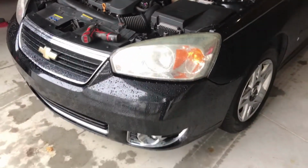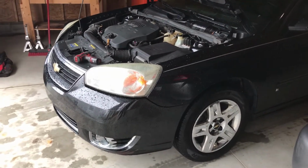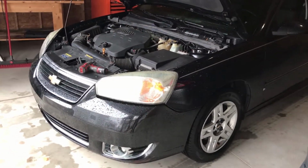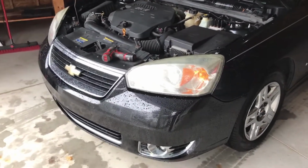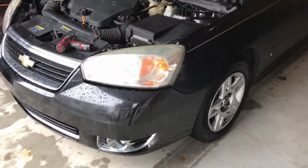We know these cooler lines are leaking because we're starting to find drops under where the radiator sits, right there. Especially when the transmission is warm, this fluid is thin. Start to find it on the floor like this. Now it can't be the radiator leaking because this car has a transmission cooler built into the engine's coolant radiator, like most cars have these days. So if the cooler is leaking internally, you won't find that transmission fluid on the ground. You'll find it in the engine's coolant. So if you're finding transmission oil under the radiator, it can only be coming from that transmission line.